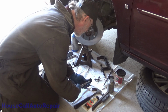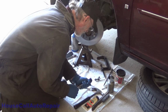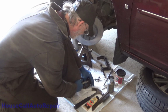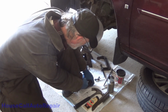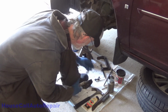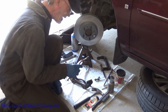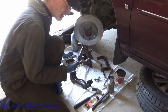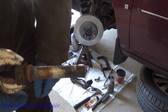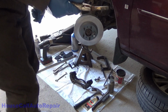Completely frozen in there, but I have a feeling they have little rubber sleeves on them, and those little rubber sleeves are holding them in place. Yeah, wow. Okay, that has a rubber pin on the bottom of it. These definitely have not been greased. This was done by a professional garage. This has no grease. I'm actually kind of glad that the garage closed.